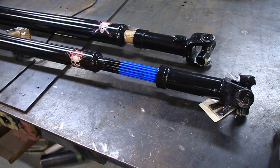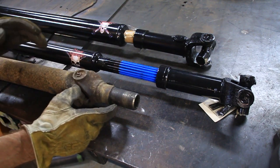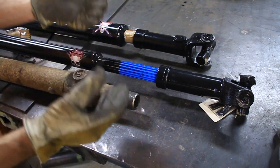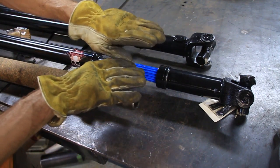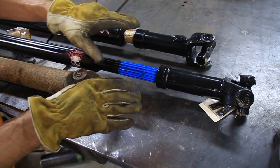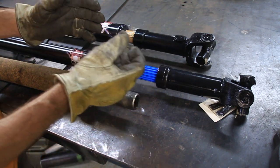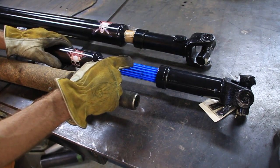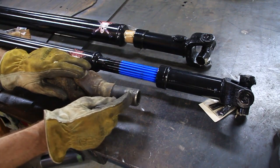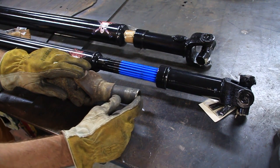Compare that to the amount on the stock shaft. The reason that you want this is because when your axle and your suspension moves up and down, your Jeep may be here but your axle has to go up and down. So you have to have a bit of play there for everything to move back and forth. Your drive shaft needs to change its distance. This new shaft can change much more compared to this old shaft, which only had about three inches that it could move back and forth.